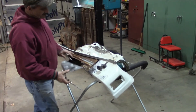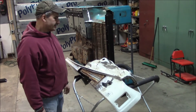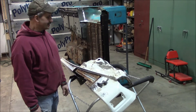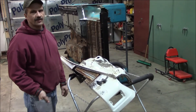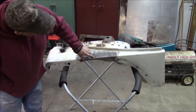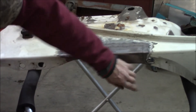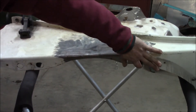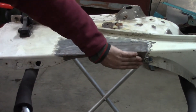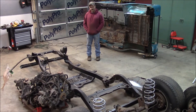But for this Jeep, they'll be done adequately. This is just a woods project, an off-road Jeep? Yeah, it's like a concourse-level restoration to run around in the woods. Perfect. Yeah, I'm overkill. This is the other side fender — I'd already put a couple of patches in. This one isn't too bad. I just had to cut this out and cut it right along this lip because the lip was still good underneath, and I welded on the edge because it made it real clean and I was able to grind it. You can hardly even tell it's been replaced there. So that's Project Why Bother — wish me luck.